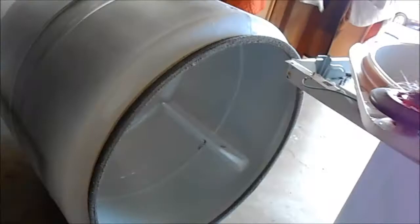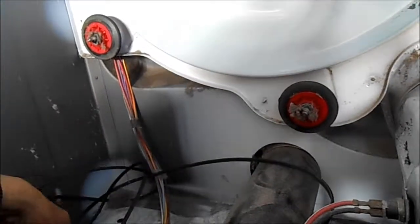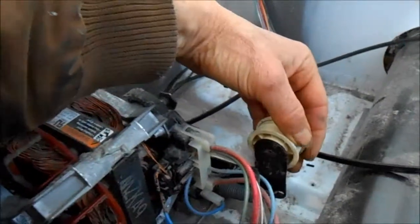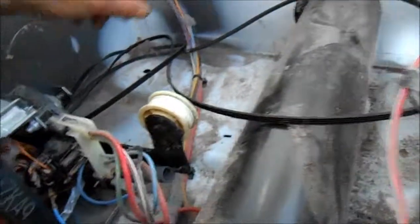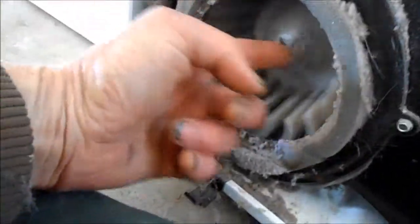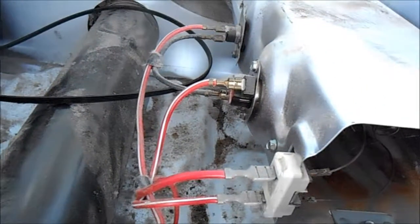Okay, it's unplugged. As you can see, we have to take the screws off the back to pull the top loose, and then there are screws on the top front panel and on the front sides to pull that panel out. This belt has a switch on it, so if your belt breaks the dryer stops and you'll see the motor spinning freely.